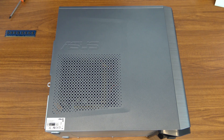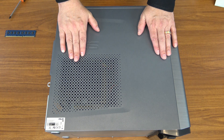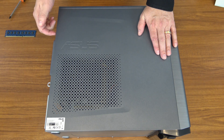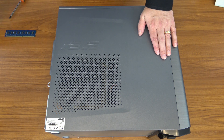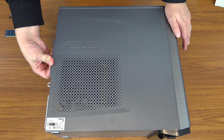I'm going to set that aside for the moment because the first thing we need to do is open our computer. I've laid the computer on the side of the desk with these vent holes open. This is the side we need to open to access our computer. There are two screws on the side that need to be unscrewed — they're right up here near the edge. Unscrew those.